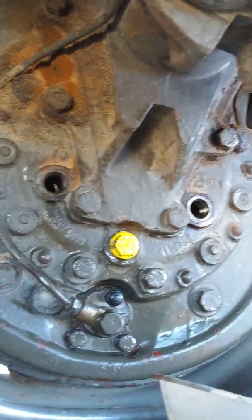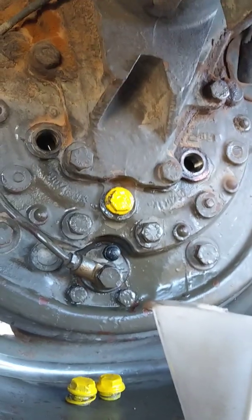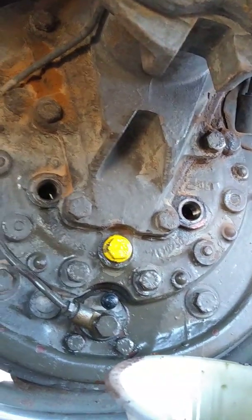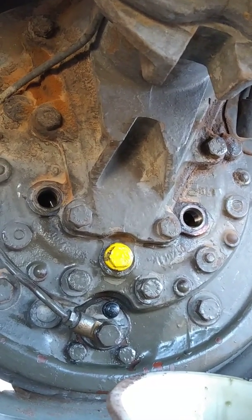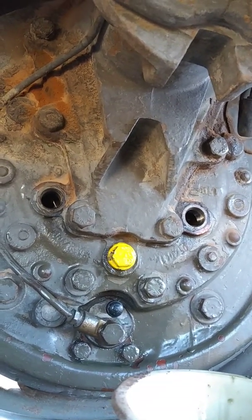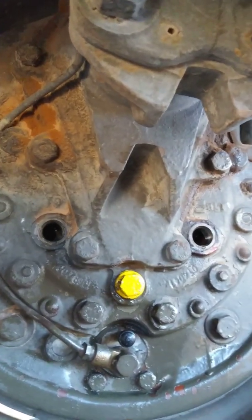You want to do this often. You can do all four corners for about twenty dollars worth of synthetic premium Mobil 1 oil, which is pretty good stuff — that's what I like to use on all my equipment. Do it annually and check it even more often than that. These things are susceptible to getting water in them; they can leak when you're going through mud, sand, and who knows what. Everything depends on that little gearbox keeping you going, so you don't want a few dollars of oil to screw up a nice heavy-duty truck.